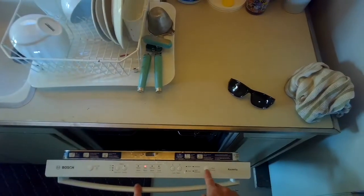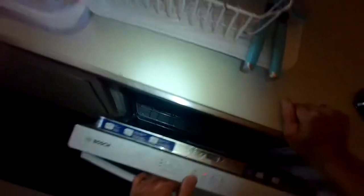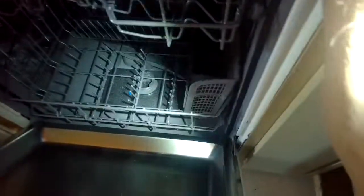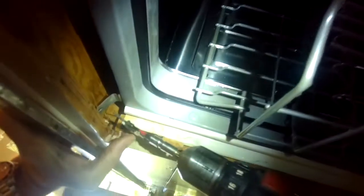Just doing a little more testing. When I fix something, I always like to test it at least three times just to make sure it's going to work really well for the customer. That got rid of all the water — great. Now that I have the dishwasher really straight to hold it in position, I'm going to add a couple of Phillips head screws on these brackets and they're going to go right into the plywood. Be careful not to go up too far because you could actually poke a hole in the top of your countertop — just go up enough to hold those brackets in place and that'll keep the dishwasher from moving back and forth.